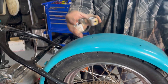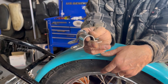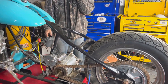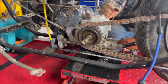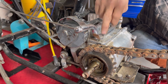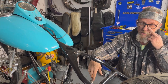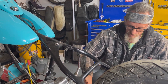Simple brackets - like I told you, these were unrecognizable, just two horseshoes of rust. I can't count the hours already on this machine just cleaning up nuts, bolts, brackets, and dissecting where they all go. Another thing on the hip parade is I need to pull this transmission off, pull the top off, pull the kicker off, inspect it and see it shifts through all the gears. I don't think I have to go into anything but I do want to check the end play on the counter shaft and the main shaft. More than anything I just need a couple gaskets and a flush and hopefully this is ready to run. But these are 80-plus year old parts - this might get torn down and be a total rebuild.